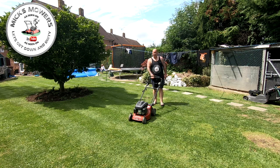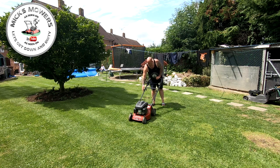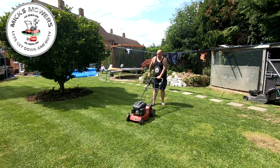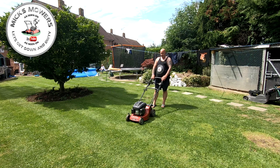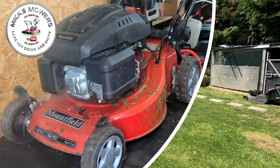And that's as far as we've got. It's actually running a bit better than it was the other day - it was really hunting and surging a lot. It's got a miss, and also if you throttle it down it should idle but it cuts out. So let's get it up on the bench and all I'm hoping to do is take the carburettor off, put the new one on, and see if that improves things.